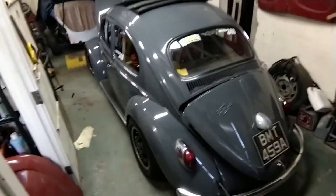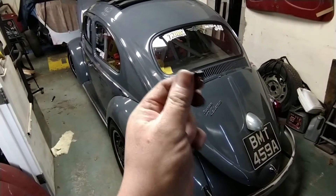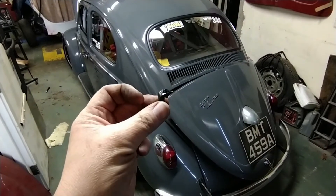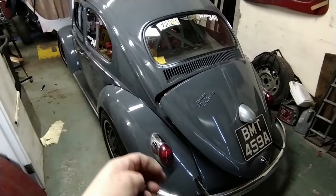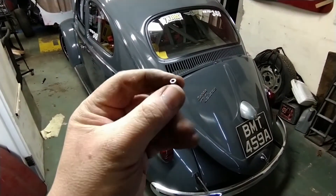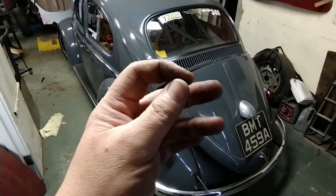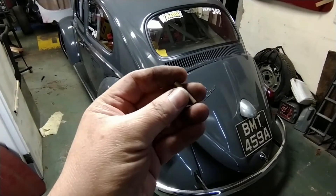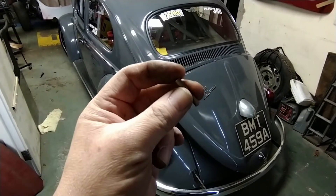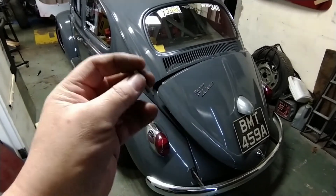But when I was moving the car just now I discovered the boost gauge wasn't working. It seems the hose that runs from the manifold up to the boost gauge has touched the exhaust and actually melted. So the first job is cobbling it back together. I've got this little piece of brake line which seems to be about the right size — nice and smooth. I did go to the local parts shop for a connector but they didn't have any that size, so even if this just works temporarily it'll do for now. I'll cut off the melted ends, join it together, and cable tie it up out of the way.